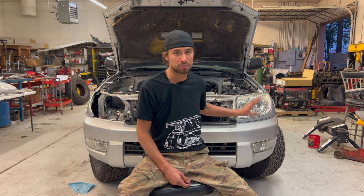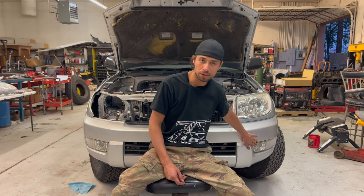So all the wiring I can move out of the bumper is better. The fog light is gonna be the only wiring I leave down here. If you look up how to do this headlight swap online, a lot of people have conflicting opinions on what to do. I know of people just tapping the daytime running light and running both, but there's reports of the daytime running light module not being able to support that wattage. So if you do it that way, you're gonna need to run LED bulbs. And then it's gonna hyper flash, so then you're gonna need to run resistors.